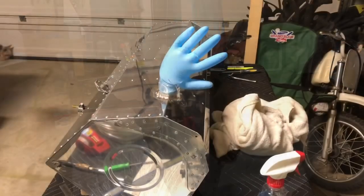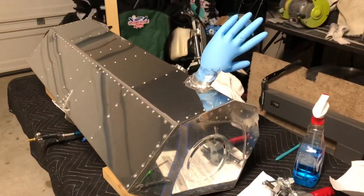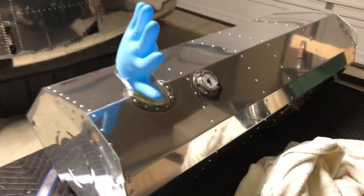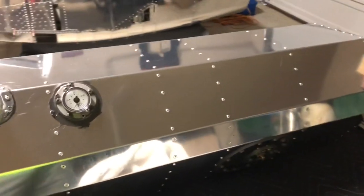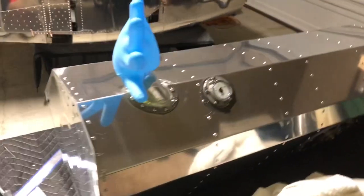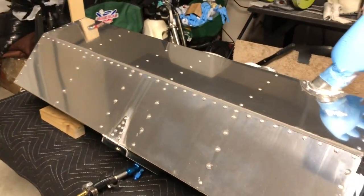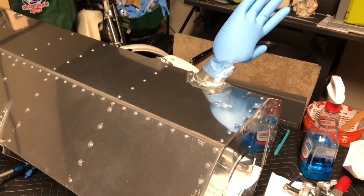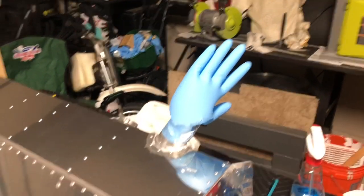Well folks, I'm completely shocked. This glove has been on here for a couple hours and it has not moved — the tank is holding air. It is a sealed fuel tank. I can't believe it. I was almost certain I was gonna have a leak somewhere, since I haven't really messed with ProSeal before. I sprayed the whole tank down with soapy water and Windex and never found any air bubbles. It took me a little bit to get the glove on there and sealed with some tape, but after a few trials I got that done and put some air in through the air valve — enough to get the glove standing up.